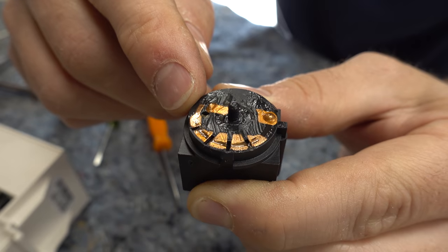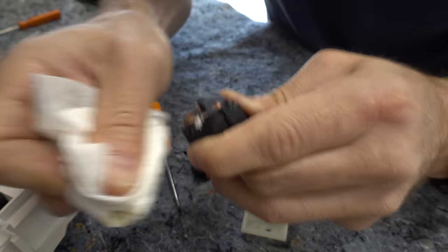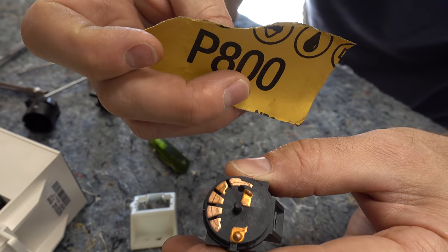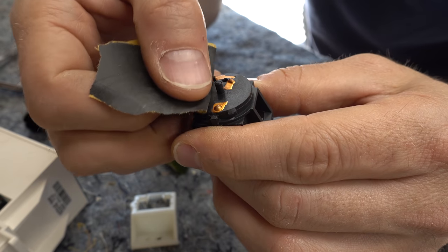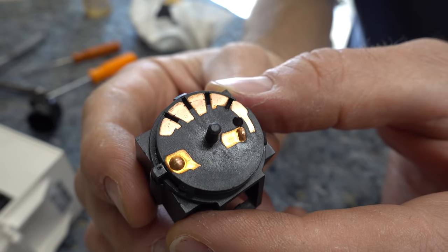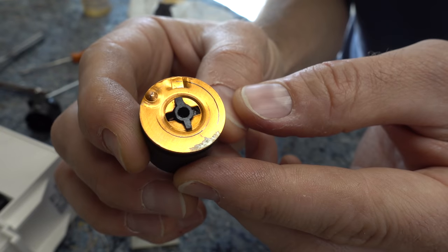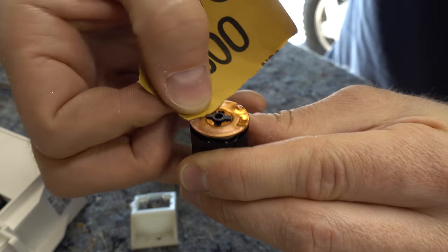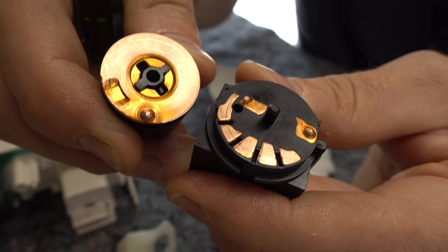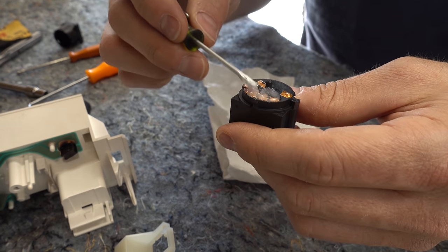It's a very simple part. You can see there's a copper nipple there and there and a couple separated contact points. I think all we have to do is clean this up, maybe give it an 800 grit sand and put it back together. I'm going to start with wiping off the grease. And I'll wipe off the grease on this side. So now what we're going to do is take a piece of 800 grit sandpaper and just ever so slightly sand down the contact points. We just want to make sure that they are clean and clear of any debris. Here is my after — you can see I didn't go crazy on those contact points, just wanted to clean them up a little bit. I'll attempt the same thing on this piece, not pressing too hard, just enough to feel it. And there is the after on this part. Now that these are both cleaned up, we're going to go ahead and put some dielectric grease and liberally apply it to everything in here.